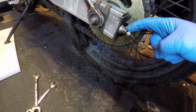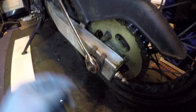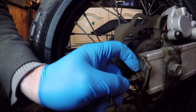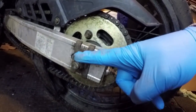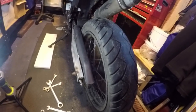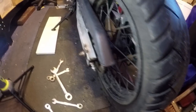So you take back this nut, and then you take back this nut. That is not right — I don't know who's put them there. This should be on a sensible mount — look, I can move it by hand. That's not right. Don't get me wrong, you shouldn't have them so tight you ruin the bearing, but that is pathetic. When you come to this side — can you see? One, two, three lines on one side. I've undone this: that's a 12mm and that's a 13mm. One, two, three, four lines on the other side — and that's a 13mm and that's a 12mm. So someone's played with it, not lined it up enough, got this wrong, and adjusted these wrong. It simply means this wheel is fitting at an angle. It must have been a nightmare riding around corners. Not clever — don't do it, get it right. So I'm going to take that nut off, swap them over — that's a locking nut anyway. Let's get these off here and get this wheel straight. The chain will then be perfect.